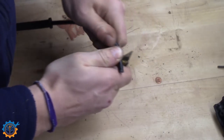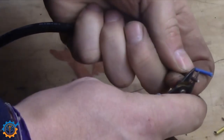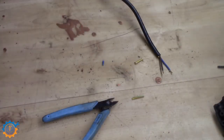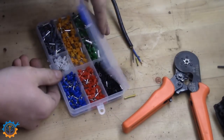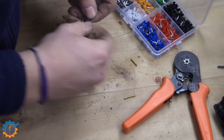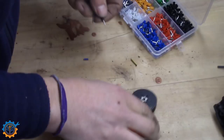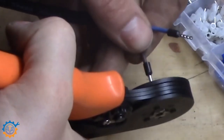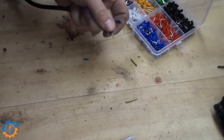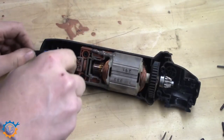Preparing the cable, cutting to length and everything. Then I add lugs to the ends — it makes it a little bit neater and nicer to work with. It really isn't needed but I want to try out the new tool I got. It actually works really really good. It's a quick solution where you don't have to solder ends; instead you get nice and firm ends. I'm just cutting off a few of the last millimeters because they will be too long otherwise.